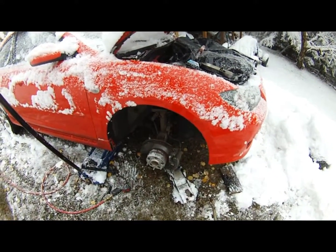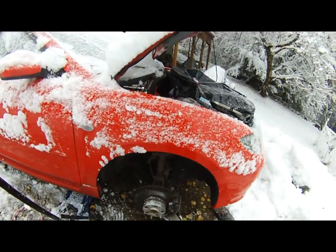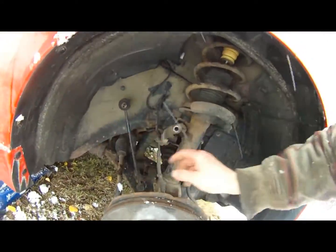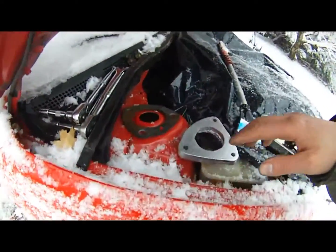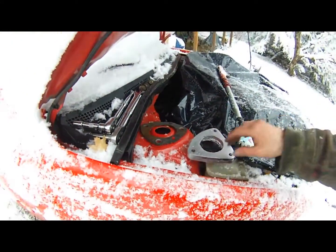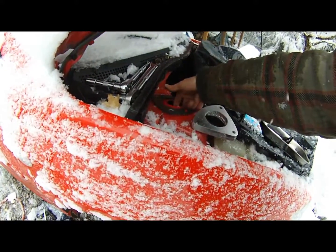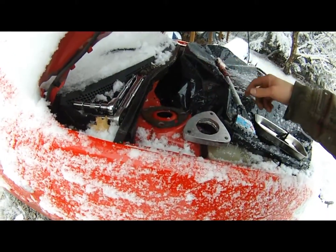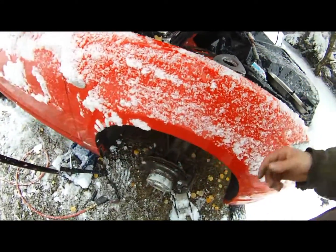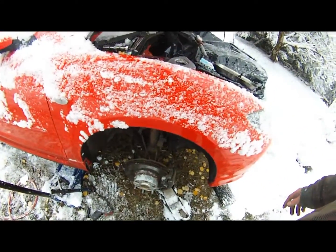I just did one side of the front and now I'm doing this side. All I had to do was undo the sway bar end link, take the three bolts at the top that hold the strut, slip the spacer piece I made on top of the strut inside there, put the longer bolts through, put the sway bar end link back on, wheel back on, and then I'll be ready to measure the difference.